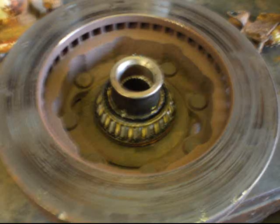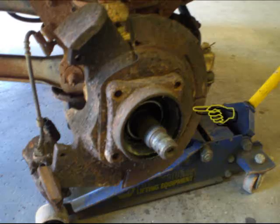When we took the first rotor off, we had a hard time getting it off. What ended up happening was all the bearings came apart, and the back of the bearing, the hub, was rusted onto the frame and the axle. Well, not the axle, but the rest of the frame for the wheel. So with a little bit of persuasion, it ended up coming undone. Cleaned it up a bit, made sure that everything would run nice and smoothly.